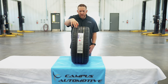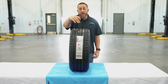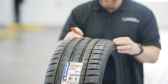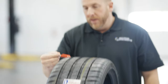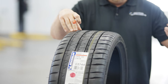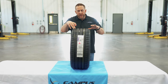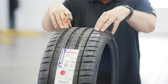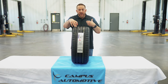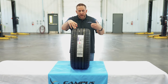Most people that buy these tires are never going to see 30,000 miles — they drive their cars hard, they know what they're getting, they love driving, and it usually causes accelerated wear. Now if you had this on the back of a Porsche 911, this tire would be much wider, and the inner rib on 911s especially on the rear are known to completely wear out before the rest of the tire — at 15,000 to 18,000 miles a lot of times they're worn out. Also, most cars you'd put these on have a staggered fitment so they can't be rotated, and when you don't get to rotate them, they all wear fast.